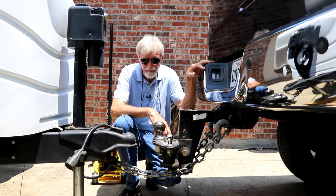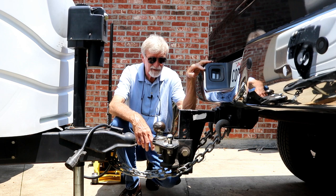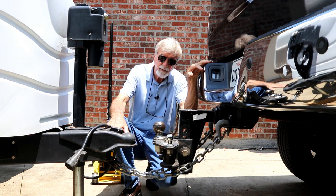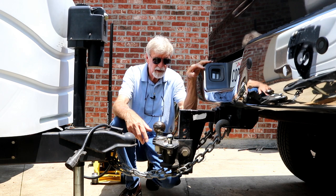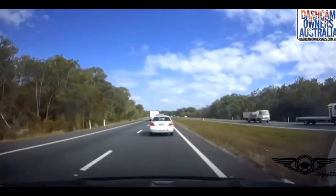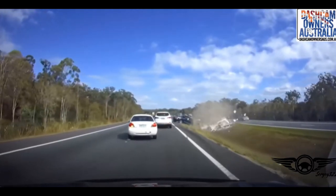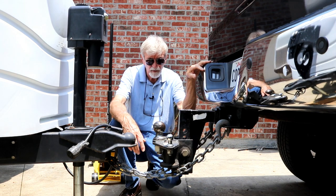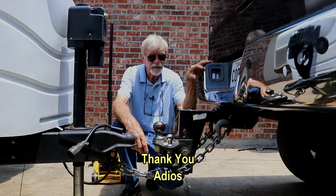I hope this gives you some ideas on things to look at. We take all this stuff for granted — I have for years — and you just assume everything's going to be all right. But for me, I want to stay hooked up with my chains keeping the tongue off the concrete. Yeah, it's going to bounce around a little bit, but it's going to keep you from being run over by an 18-wheeler or flipping. Ideally you want your umbilical hooked up so you have trailer brakes too. With my light setup I can handle it with just truck brakes, but it depends on what you're towing — you don't want to go jackknifing on I-10. Anyway guys, thanks for watching — until next time, adios.